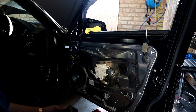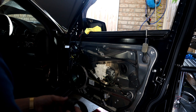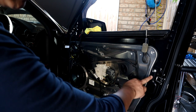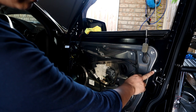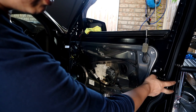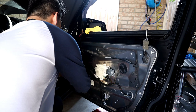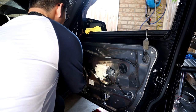That's basically how you remove the door panel on a Mercedes-Benz W204. Even from here you can also remove your door latch — there's probably a T30 Torx screw right here and if you remove that, this door latch should come off. Also from here you can even access your trim.